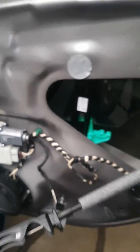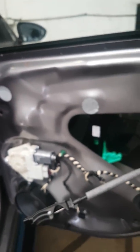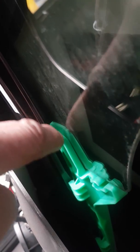Then you just get your hand on the top of the window and just give it a crack. You can see that the pin pushes the slider apart — what it does is it just spreads them apart, pushes itself down, and then locates itself back in that hole.